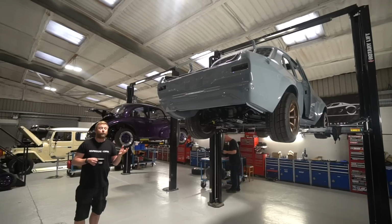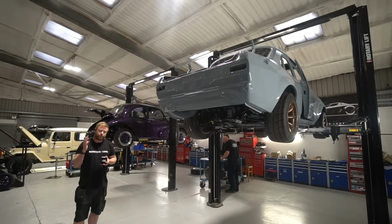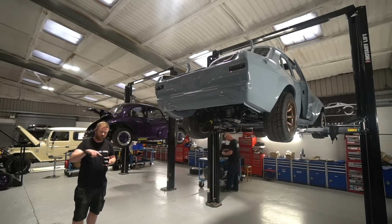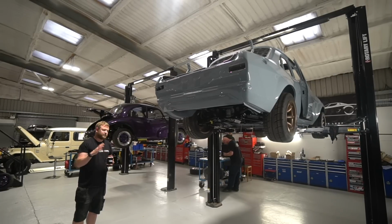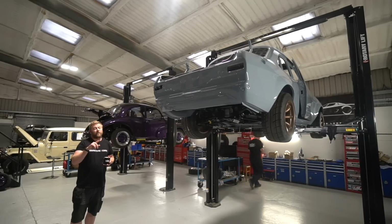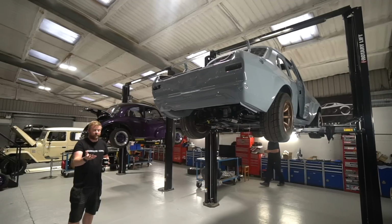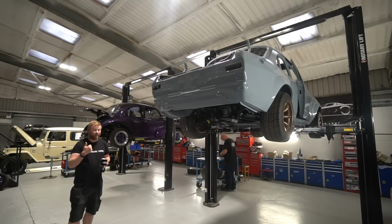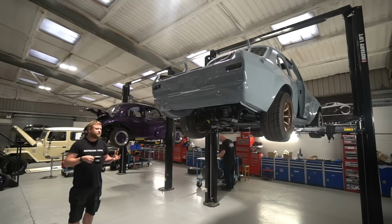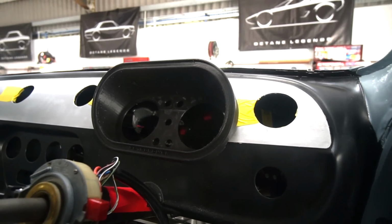It's also going to control the warning lights, which is good, because that means we can use the MoTeC PDM that's controlling all the electronics on the car, rather than having to splice the wires out on the output for things like the oil pressure warning lights, indicator telltales or whatever. The CAN box will basically read the CAN communication stream from the PDM as well and operate those various telltale lights. Again, kind of cutting down on duplicated stuff and wiring that doesn't need to be there. So yeah, that's looking really good.